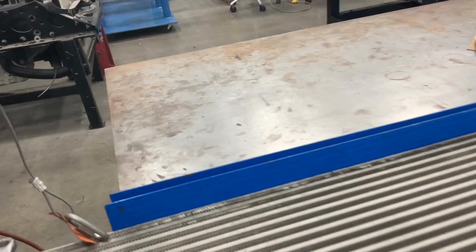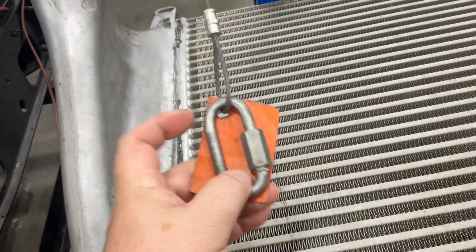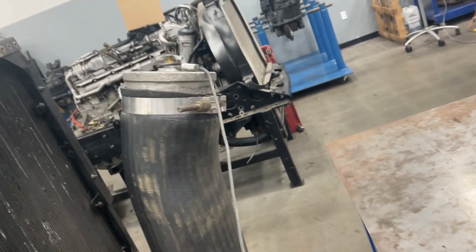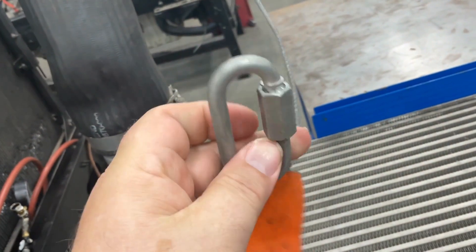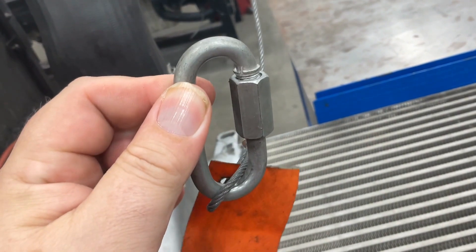You can see that these have safety chains. If the clamp holding that cap wasn't very tight, 30 psi doesn't sound like a lot, but if this cap decided to pop out of there, it could do some serious damage. For safety reasons, when you do this test, you always want to make sure one of these clamps is attached to something that's going to keep that cap from flying too far.